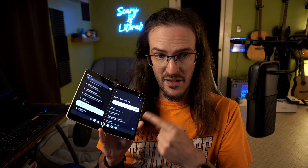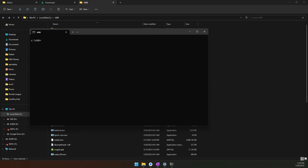Make sure that developer options have been enabled once again — you'll have to do that again. Make sure that USB debugging is turned on. At that point, you can plug your Surface Duo into your computer and you should hear the connection noise. Then we are going to simply run a series of commands. I'm going to put these commands in the description in the order that you need to run them. The first one is ADB Reboot Fastboot, which is going to put it into the mode it needs to be in.